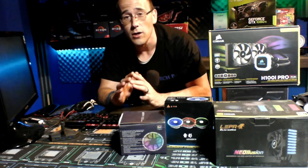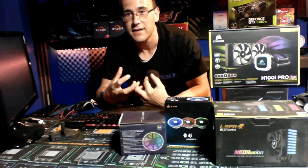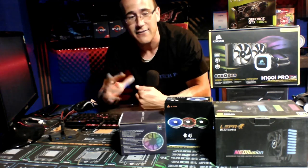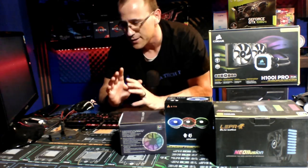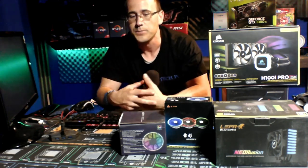I don't recommend putting your computer on the floor because it will literally suck in everything that you have on your floor. When you walk, your feet kick up hair and dirt and everything else, and if your machine is running, it will just suck it right in, and that's not good. You really don't want that. So I tell people, put it on your desk. You can use dust filters. Those really help to bring clean air in.